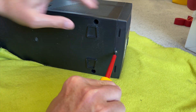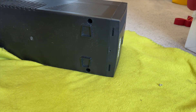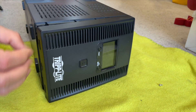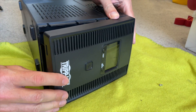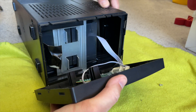To get to those internal batteries you need to open up the unit by removing the Phillips screw located at the bottom of the front panel. Angle off the bezel and with a little bit of wiggling you're going to get the display off, while keeping those internal cables that drive the display in place. You can't remove those.